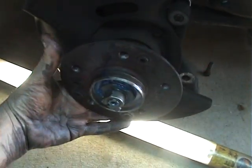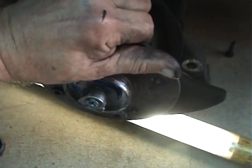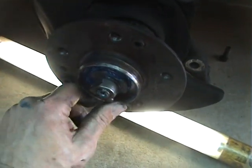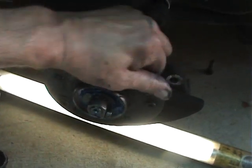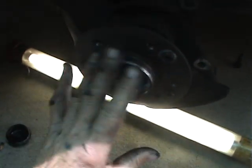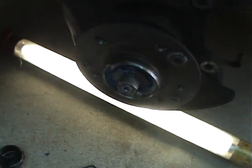That's all back together. What I do is tighten the nut up so you can't turn it — see, I can't spin the disc hub. Then I just back it off a little bit until she moves. Reasonably tight, but she'll come good. Now I'm going to pack more grease in there, tighten up that lock nut, and put the dust cap back on.